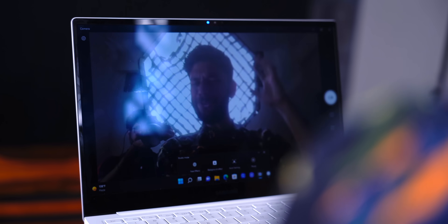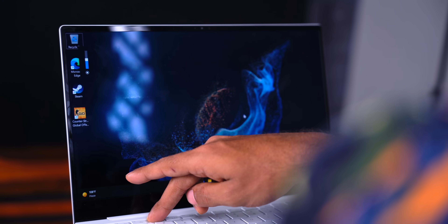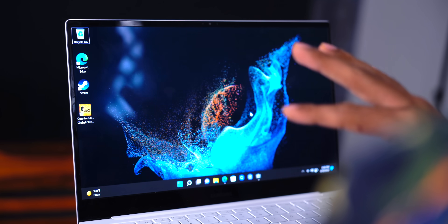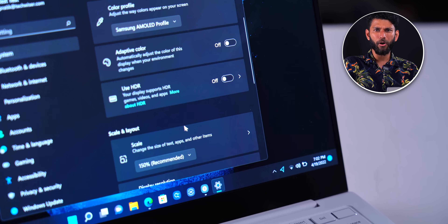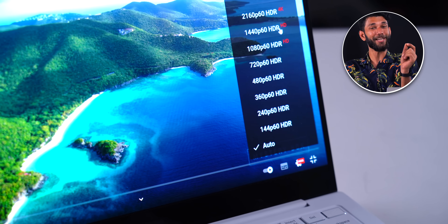You would say your phone supports like 1200 nits — what is this 500 nits? Well, the bigger the display is, the bigger the pixels are and the more light they throw at you. So 500 nits generally would be as bright as your smartphone display. There is a big bright studio light behind me, and if I minimize and go to the desktop and increase the brightness to 100%, you can see a bit of glare, but the display is still bright and sharp that it shouldn't be a problem to read what's on the screen. You can also turn on HDR and watch HDR videos on YouTube.